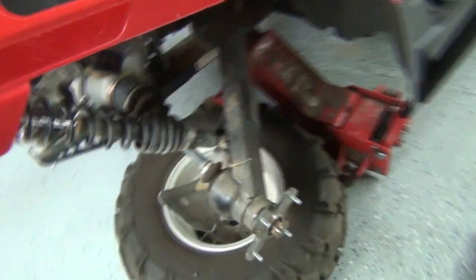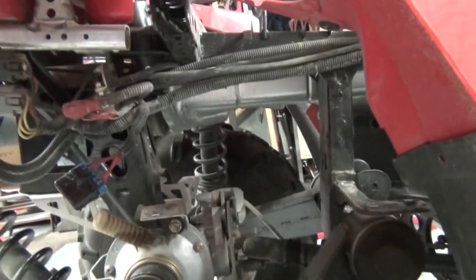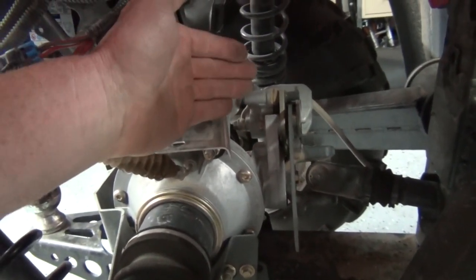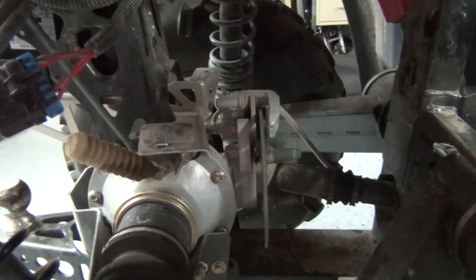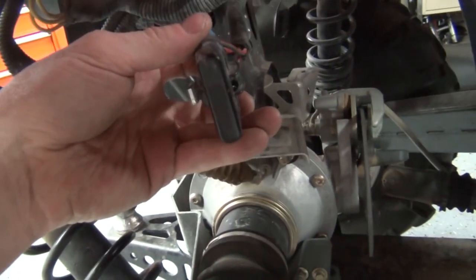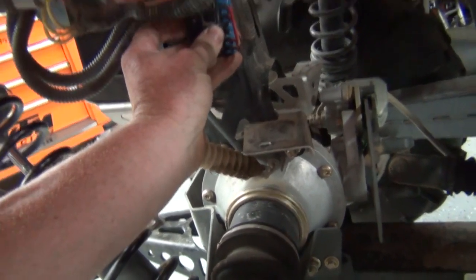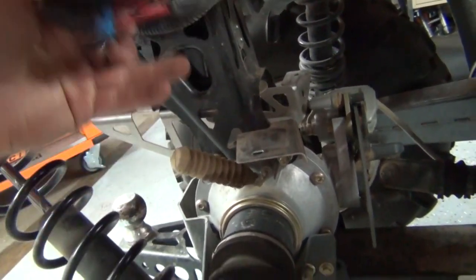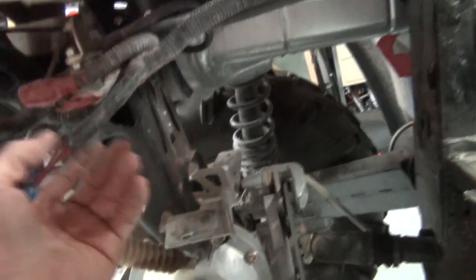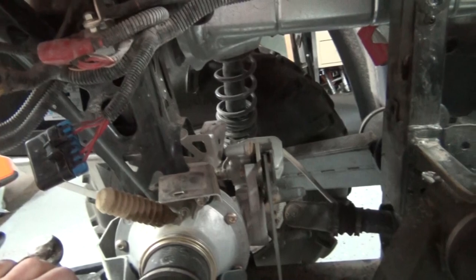Once you get all that pulled out, you can pull the tank out through the opening. It just comes right out - not exactly. It hangs up like crazy right here; you have to get a pry bar and flex the tank this way to get it to come back out. Remember the DLC or Diagnostic Link Connector - it's clipped up in here and it's going to be in the way, so you've got to pull these wires up quite a bit, pull it out of the way, and then the tank will come out.